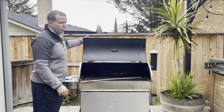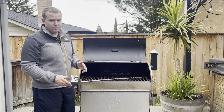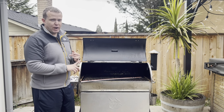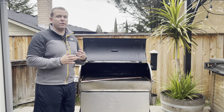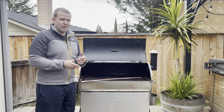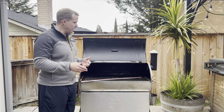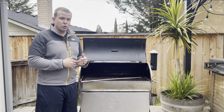Somebody aligning the bullhorn handles on the backside while you get the screw started is a definite advantage. One last note on the RTV. The manufacturer of this product does recommend that you have an ambient temperature of about 50 degrees or so outside. That just makes sure that the product flows out of the tube nice and neat when you're applying it. And it does have a cure time of about 12 to 24 hours.